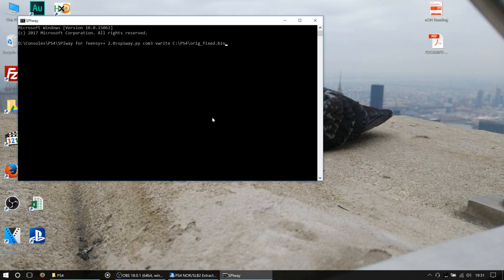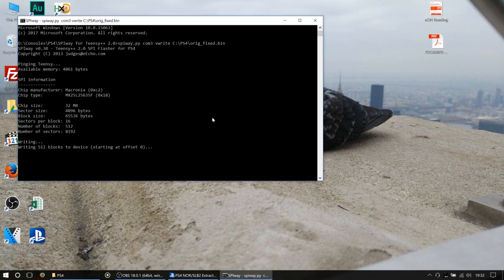This is firmware, remember. It is very easy to brick things. It's not just a case of, I'll just reflash it. You may not have that chance. It can send portions, updates out to other ICs on the board. I have seen it and I have heard of it on several occasions where somebody's misedited the file, or they've rewritten a copy back to the chip, put the chip in the machine, and it's just constantly pulsing a blue light. When I was trying to work this out myself way back when, I did it to a crap machine I had as well. So I know you can do it. So trust me, use VWrite and just wait for 2 minutes, okay?